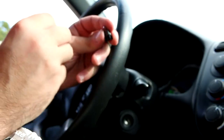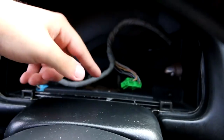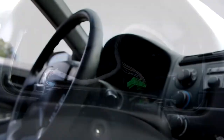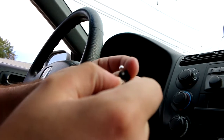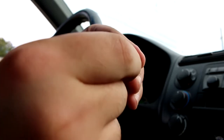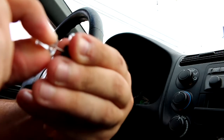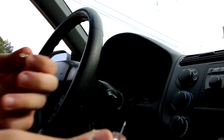You need a thumbtack to pop out the little light bulb — I'm going to grab one. Last time it was really dirty in there, especially on the bottom parts, and I wiped it down a bit trying to keep the car clean. All you do is slide it into the little crevice and pop it out — dig it in there and kind of raise it up and it knocks the bulb out a little because it clips in there.